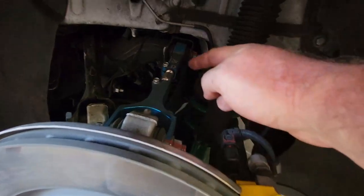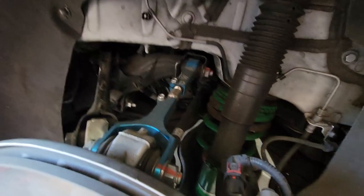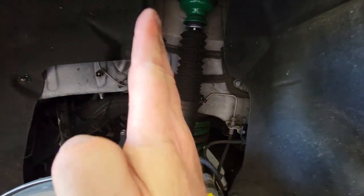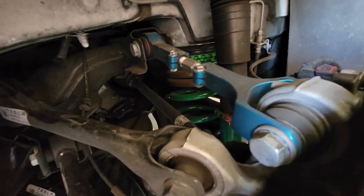So on top of it getting raised next Friday, Martian Wheels has the boss nose wheel spacers — I have four of those inbound. I was hoping they'd be here today so I'd only have to do all this once, but yeah, 15-millimeter offset. So we're going to push the tires out just a little bit, and that should really even out the look on this thing. And just about got the backs done — this is the Mountain Pass Performance adjustable camber arms. If you lower your vehicle, your camber is going to change. What these do is allow your wheel to sit properly so you get proper tire wear, handling, and balance. They did a damn good job, and you can see by the pen marks nothing has moved. Big ups to Steve over at Zev for putting this all on there.